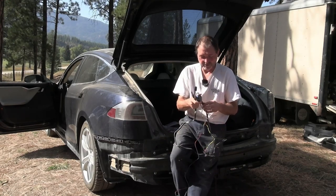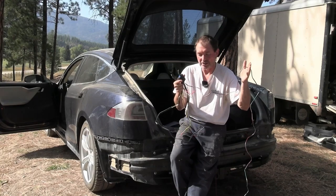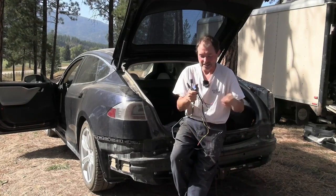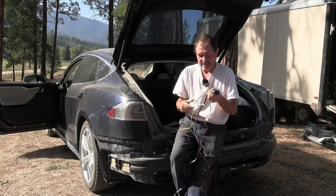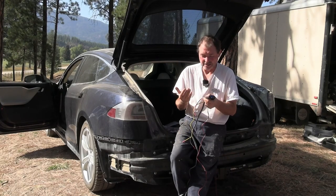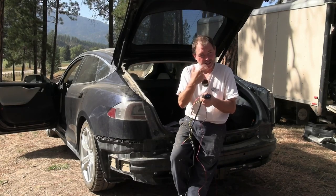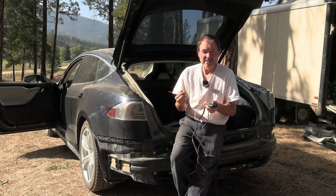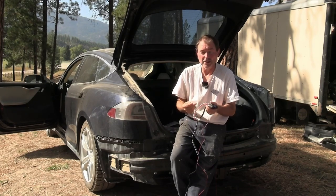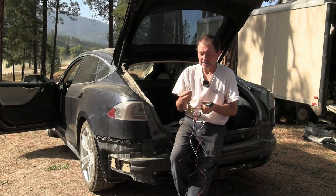So first of all, even with having the brake input on this box and the other box, we don't want to use the brake input at all on the Tesla. That makes it the worst. Then it gets better after that, because we have a left turn signal with tail lights, with all the lights flashing, and we have a right turn signal functioning properly. We have tail lights by themselves functioning properly. So we're pretty close. The problem is the turn signal and the tail lights together.